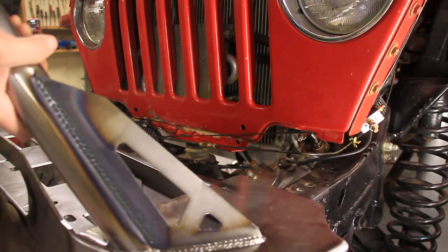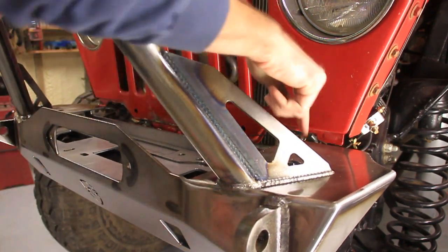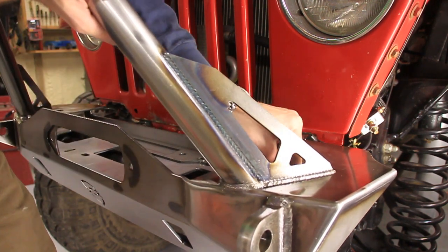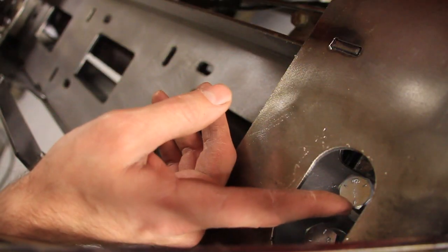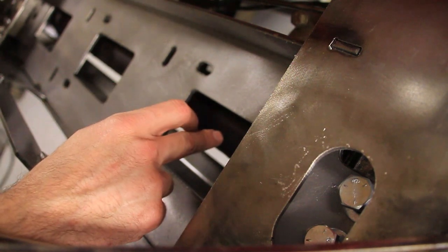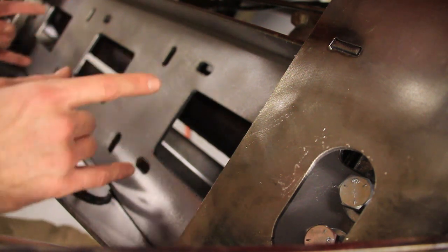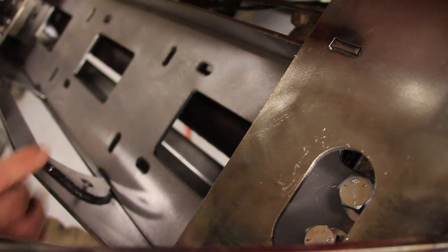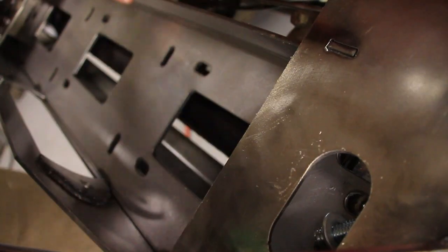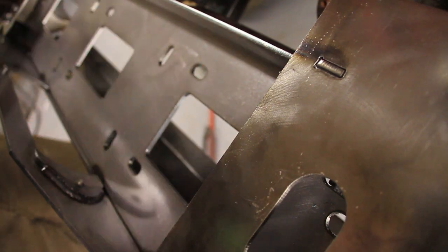Putting the bumper on is just as easy as taking it off — you're just going to slide it on. Now we've got a couple bolts to put in. Those bolts are provided by JCR with washers and they just go down into the holes right here. Before I tighten those up, you need to decide if you're going to put a winch on right away, because you won't be able to get to those bolts very well once it's mounted. What you can do is mount the winch on the floor, or have a buddy help you tilt this thing back, then slide it out just far enough to get those bolts into the winch, and slide it back on.